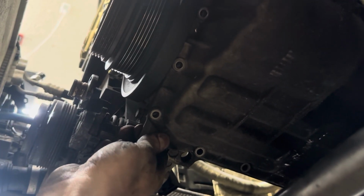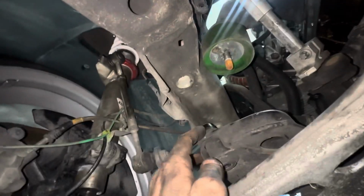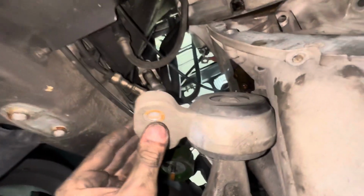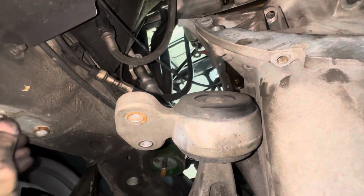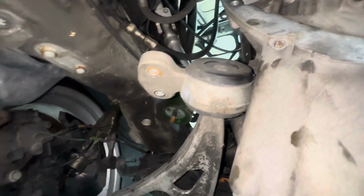It acted like it really, yeah, it just wanted to come out already. Huh, that's nice, okay. Yeah, so I removed the 4 bolts over here and over here, and then I just had to loosen up one control arm, which you could get a longer bolt and put it in here to hold it in place because it's gonna push against the pan like this because the wheel wants to come backwards, so I'll probably do that. But obviously you got all the room in the world to pull the pan out now.